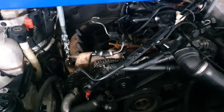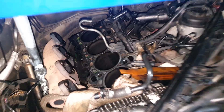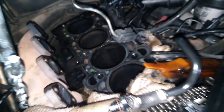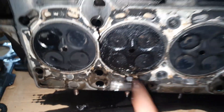Welcome to part 2 of this complete series. What I thought would be preventative maintenance ended up having to be a complete engine rebuild. Continuing from the last part - as you can see the head is out of the car. The bores actually look fine, there's no scoring or ridges on the actual bore itself, so I got away with that. When it comes to the head itself, you can see cylinder one, two, three and four - the worst of the worst is cylinder two.